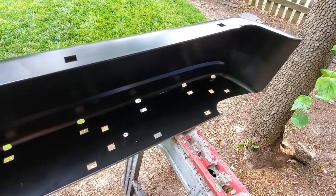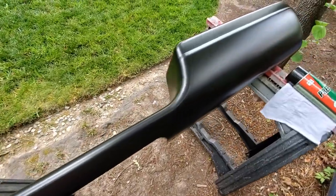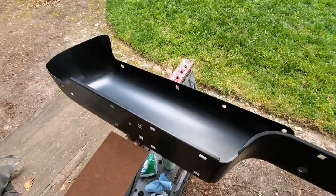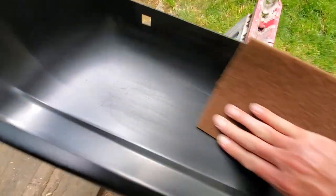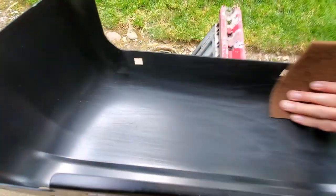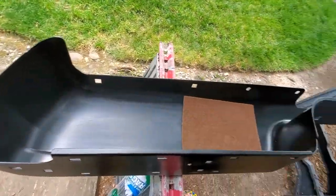Hopefully that'll keep this bumper lasting longer than my previous one. After wiping it down, the next step is to go over all the surfaces with the scour pad to rough them up, giving the bed liner product something to adhere to. So first I wipe it down, then we'll move on to the scuffing process. I'm doing the backside first — just going over all the surfaces. You can see it's scratching it up pretty easily, which will give us a good bonding surface for the liner to adhere to.